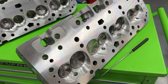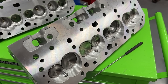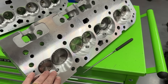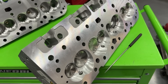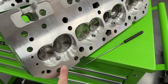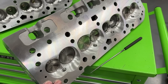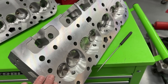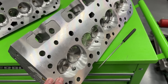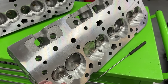The disadvantage is you're changing the entire angle of the head. Now before someone thinks this — because I thought it too when I didn't know — you cannot really alter the valve angle enough to matter. You cannot go from a 23 to an 18 degree head by angle milling. What you'd end up doing is milling almost a quarter inch on just one side and you'd end up with nothing there. The best you can hope for is going from 23 to maybe 22.5 or 22 degrees — that's really pushing it.